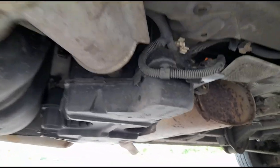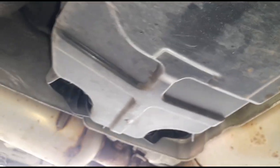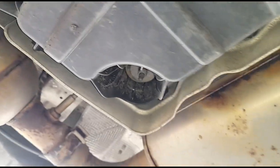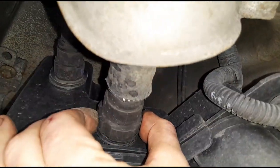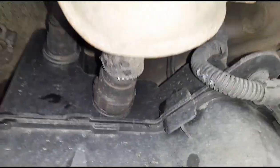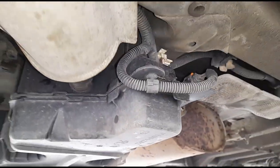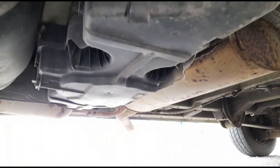If I come under the vehicle, we've got the tank right here. Looking underneath we've got what looks like four 10mm bolts, so it shouldn't be too difficult a job. There are also a couple of pipes to disconnect — like a giant fuel hose there and another one up the top. We'll try and get this disconnected and programmed back in once we've fitted the new one.